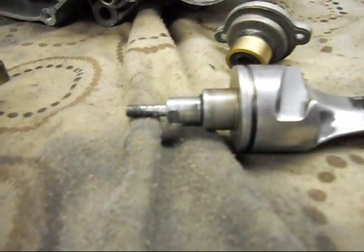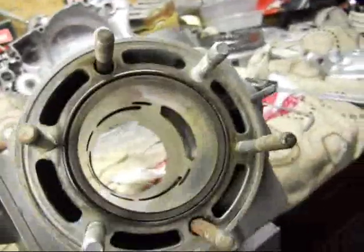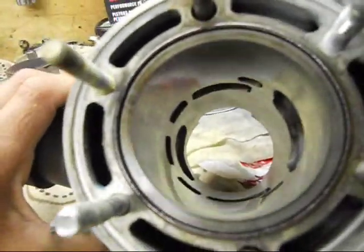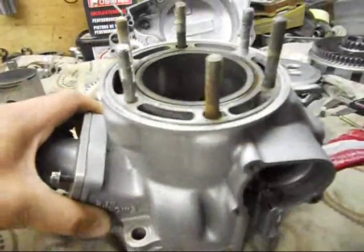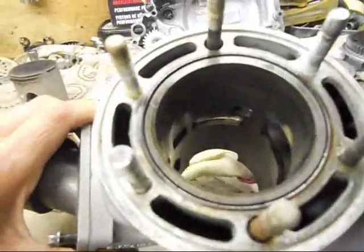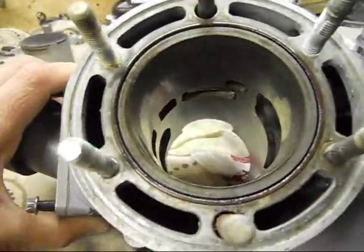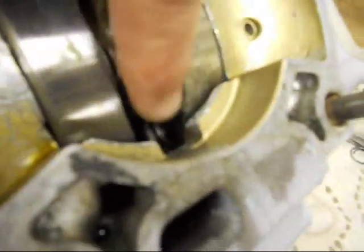I got a bit worried thinking oh no, I haven't found an '89 one, but anyway the damage in here wasn't too bad. I just honed it up a little bit — looks like a pretty good barrel. I think they've blown it up before, the original power valve perhaps collapsed in there and it's a little bit scored, but it's below the fire stroke so hopefully it won't affect the rings too much. It's a good barrel — 68 mil, spot on, hardly worn in three or four different places.